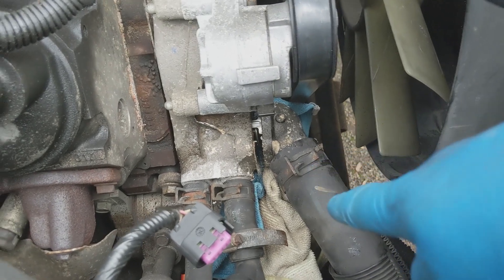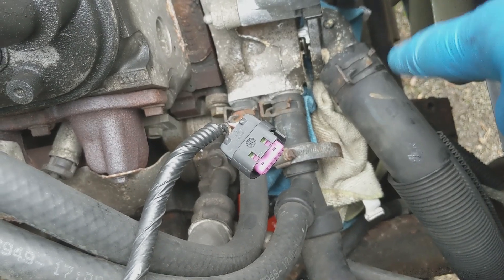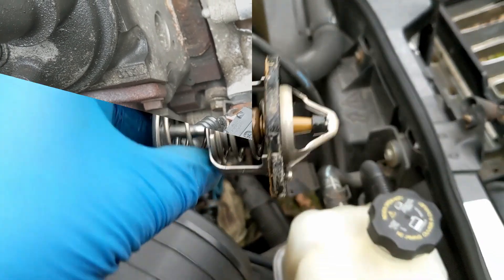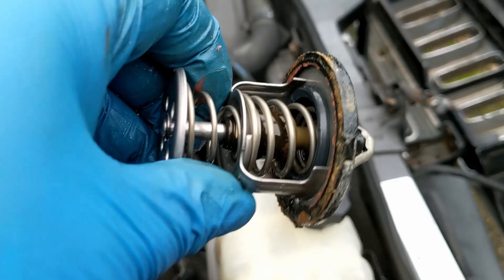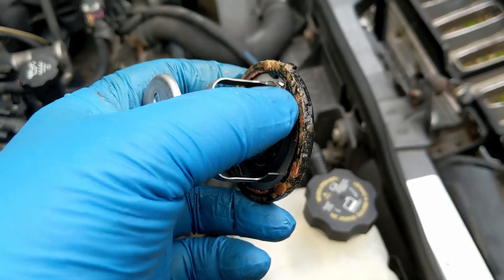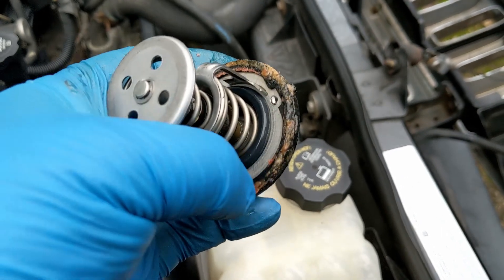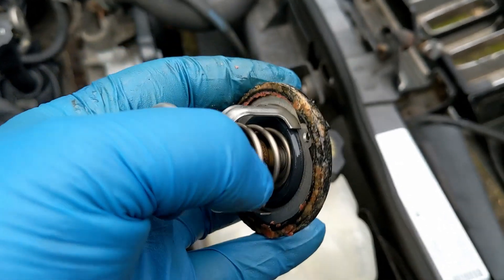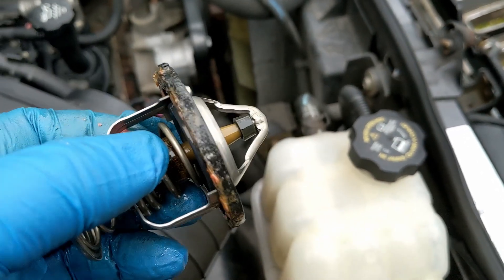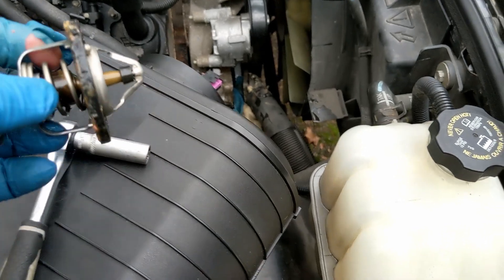It may have been better to disconnect the hose first, because I need to make sure the mating faces on the thermostat housing and the pump are clean before putting it back together. I've pulled out the old thermostat. If you check the service manual it tells you how to test the thermostat — but would you really bother? Once you've gone to the trouble of taking one out, I think you're better off just replacing it. They're not that expensive — my replacement was just pence.